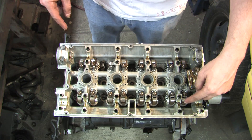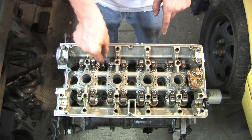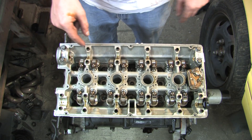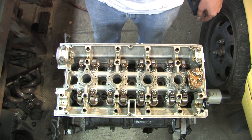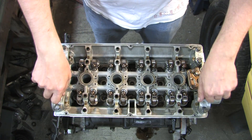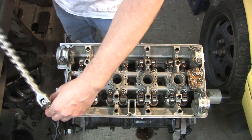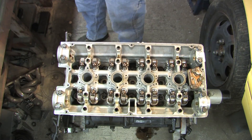Alright, so what's left in here? We have our rockers, we have our lifters, springs, and retainers. We have to keep all of these things separated and identified with which valve they go on. The reason this is important is because their sizes and wear marks are unique — mismatching parts introduces different wear patterns on contact surfaces which can shorten their life. Also, if we find a deeper problem on any particular valve, we can go back and reference all the parts connected with it.